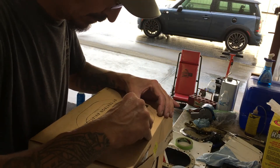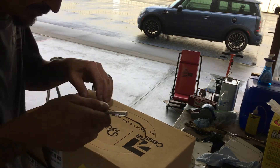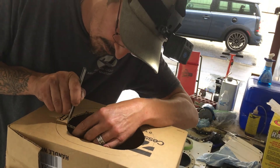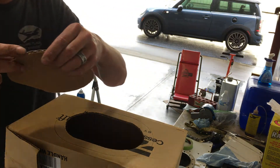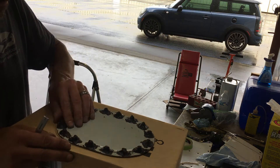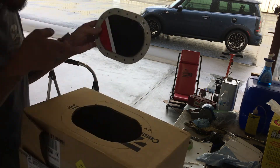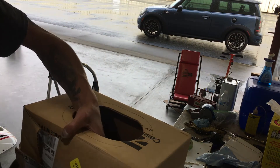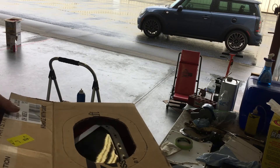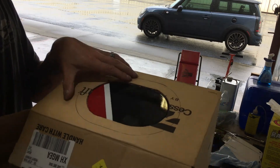Now I'm going to take the razor and start to cut the center out. The panel needs to sit from the inside out, so the center hole is the most important part — that's what we're going to be cutting into the aircraft skin. I really don't want to put metal back, so I definitely want to get this right. I take the panel and flip it upside down — if the hole's right it's going to sit inside — and this is just a double check to see how it sits, the flushness of the hole, and if it allows it to go all the way around.